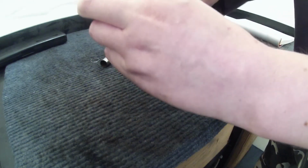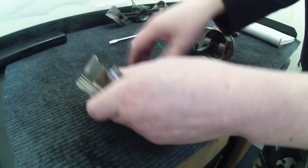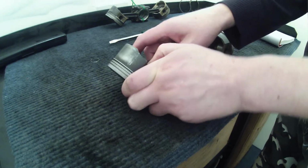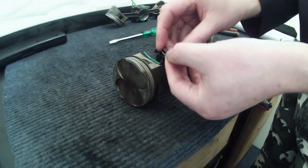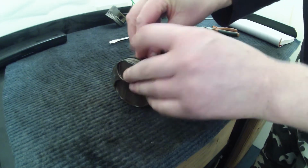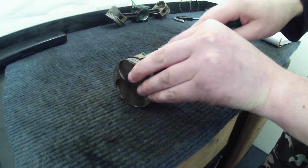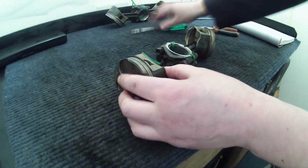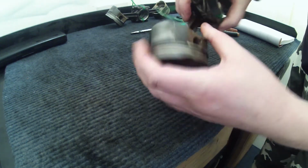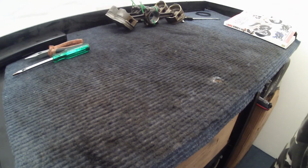So all that remains to be done now, notice there's a wee bit of dirt inside that piston as well, is just reassemble this one. Keep getting these the wrong way around. This goes through the top of the con rod. Then we've got this piston circlip. Let's put that in. There we go, that circlip in. That's all fine. So that's all the pistons and the piston rings checked. So that's great. Thanks very much for watching, and I'll see you later.